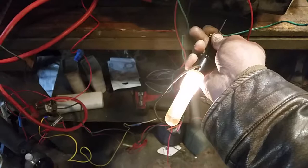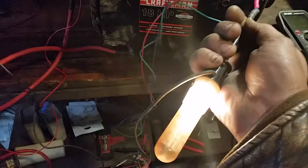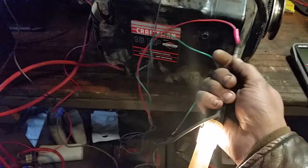My test light is hooked up to battery positive, so it's searching out a ground. That will ground out the ignition when the key switch is in the off position. Next is the accessory circuit — the light circuit. I'm hooked up to battery negative now, and with the key in the on position I get power to the accessory, so the charging system. This power will also run out to lights and whatever you need battery positive during the run circuit. When the key is in the on position, we get continuity from the battery power to the charging and light circuit.